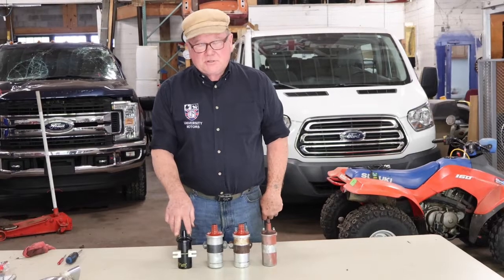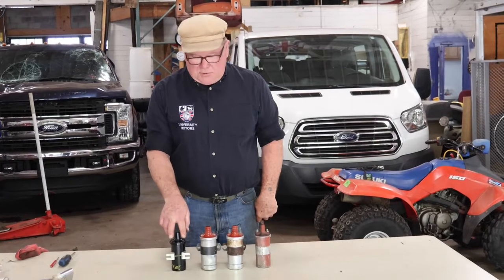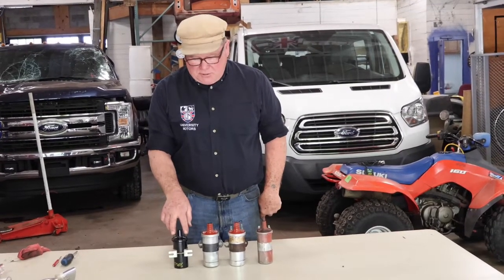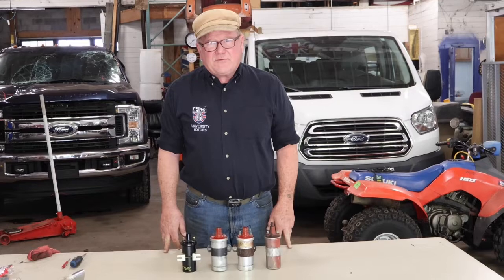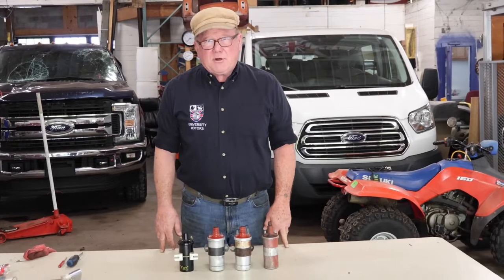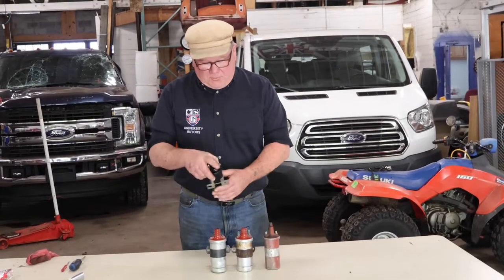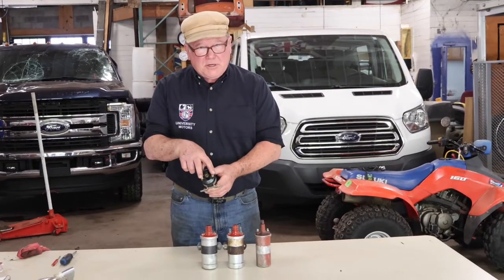The very difference between a normal 12-volt coil used from 1945 through 1974 and 1980 — that's got three ohms — but 75 through 79 has only got one and a half ohms. Sometimes it's not easy to tell from the package. The 18-year-old guy selling you the coil at Pep Boys doesn't know what an MG is; he doesn't even really know what a coil is — he's just selling you a box. So best if you put your ohm meter on it and just check it before you mount it to make sure that it's a 3-ohm coil.